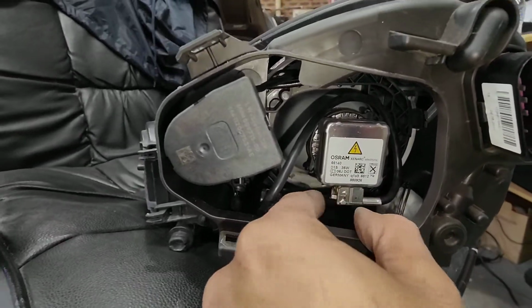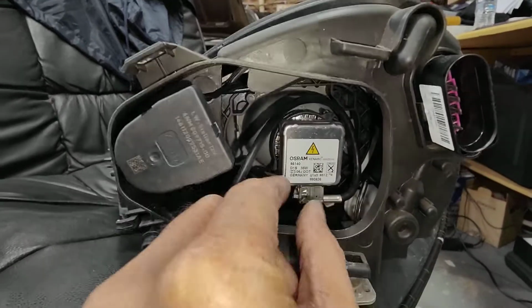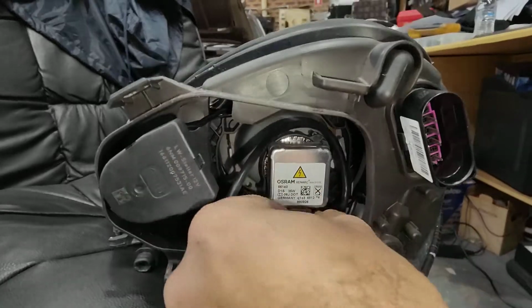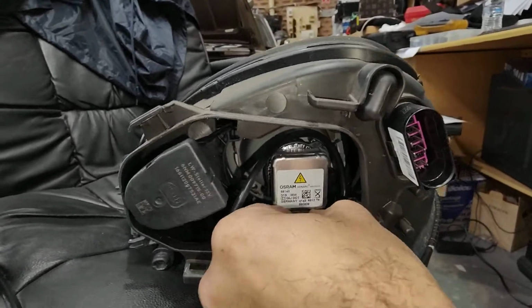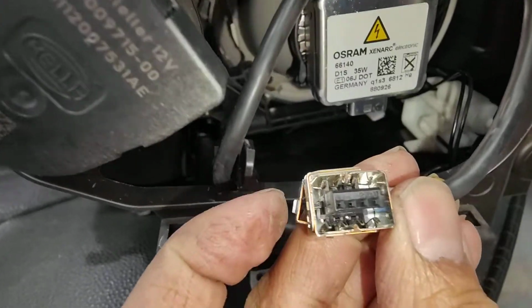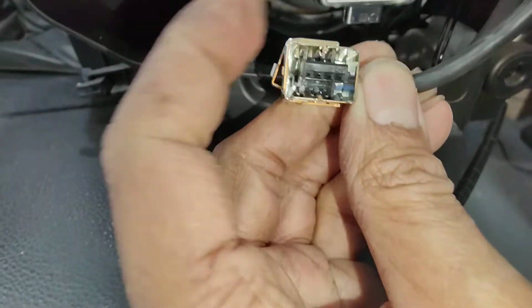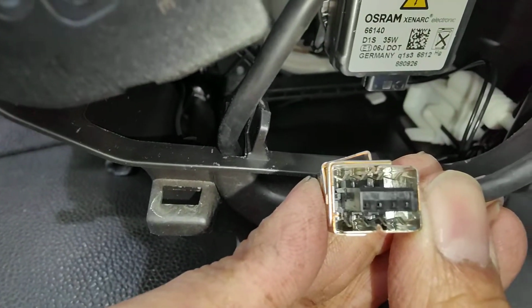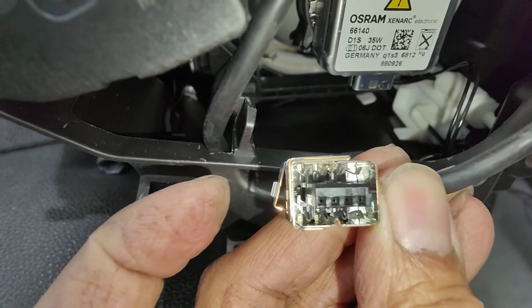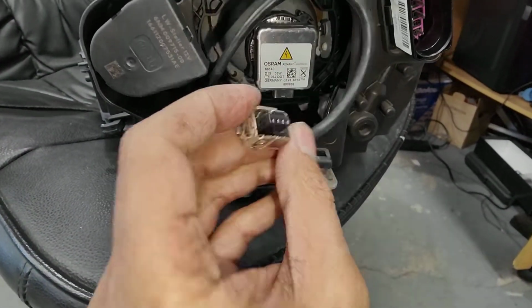The little clip there is a spring clip. That's your spring clip lock. So press it in and then just pull down on that globe like that. It's pretty hard to do one hand, but I can do it. See here, there's your lock. The little thing locks in, unlock, lock, unlock. Make sure you do that, otherwise you'll damage the actual plug.